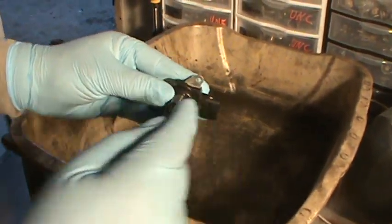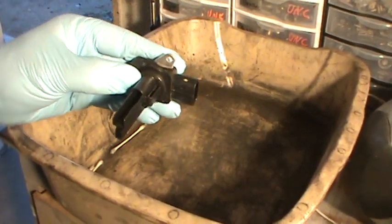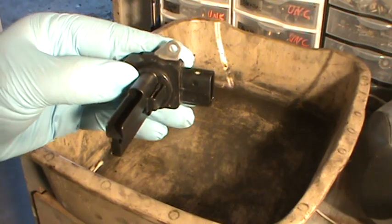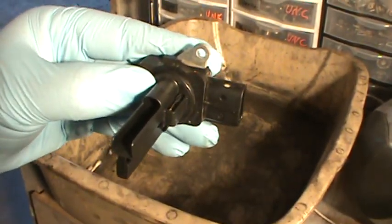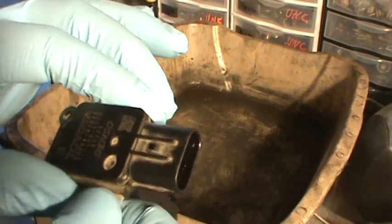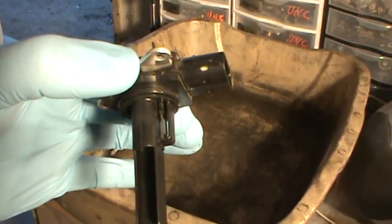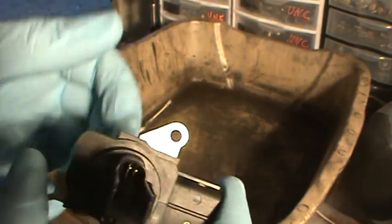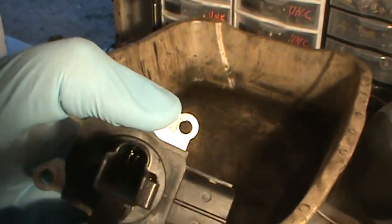I've done this before with this particular vehicle. And in my previous video I was checking the voltage signal and the voltage increases — that's one reason you get a code like P0171, P0172, P0174 — because of the dirt and crud. If you don't take care of your air filter, you get dirt and grime. And if you use a K&N filter, you can get buildup because they use oil. Some people spray too much oil when they re-oil it and it'll build up on the sensor.